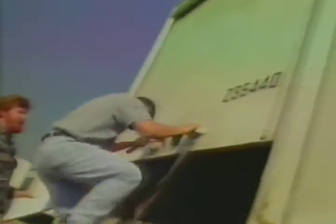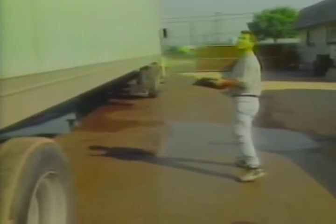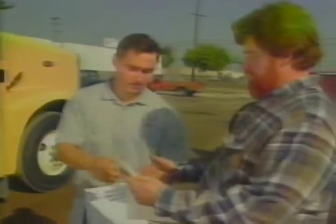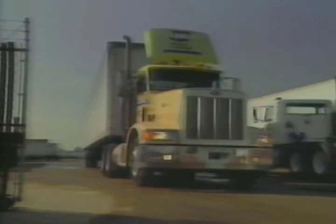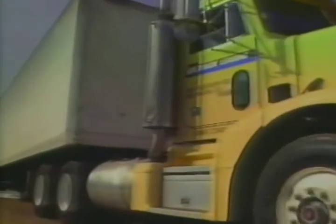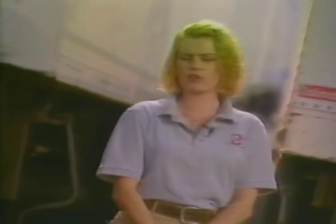Upon return, we need to check for any new damages and any new situations that may have occurred with the trailer that would cause it not to be road-ready. We check every single part of the trailer — from the roof to the undercarriage, the tires, the brakes, equalizers, airlines, bottom rails, everything. We will go from the front of the trailer to the rear, open and close the doors, go inside and look at the roof, the floor, and the walls. On a reefer inspection — that's a refrigerated unit — we also need to check the fuel amount in the tank and the hours on the reefer to make sure we don't charge the customer for hours they haven't used.